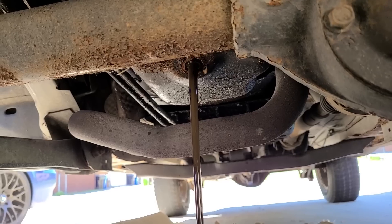Let's get some stuff out of the way so we can take out the entire fuel rail. That's pretty much just the linkage for the throttle. We're leaving that bracket — I think we can sneak this stuff out. There we go. Come to me, injectors. Just like that, we have our injectors out and I've already removed two of these guys.